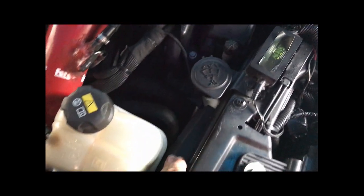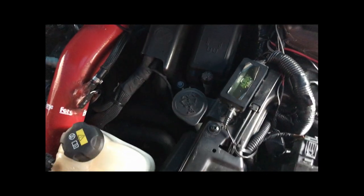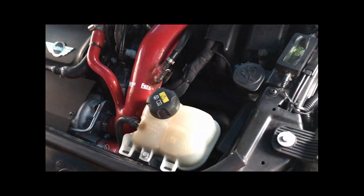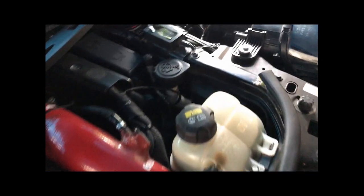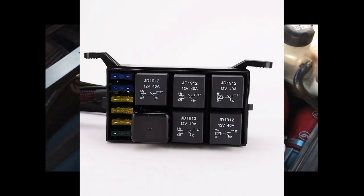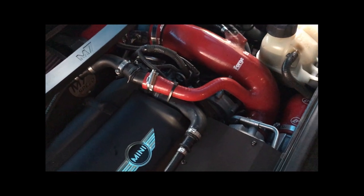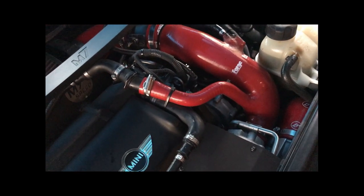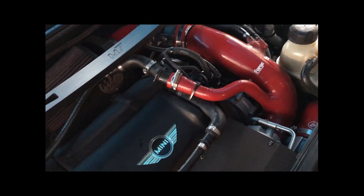That box actually controls 6 different things. It controls big light, it controls small light, it controls color light, it controls work lights, which is color light turned to white, and it controls the internal remote control for the winch. All that's controlled from that one box, which has my breakers in it, or fuses, and it also has my relays, which uses 30 amp auto relays, and it has one 50 amp relay. So if you're going to put some big mother of a light, it has one relay designed for that.